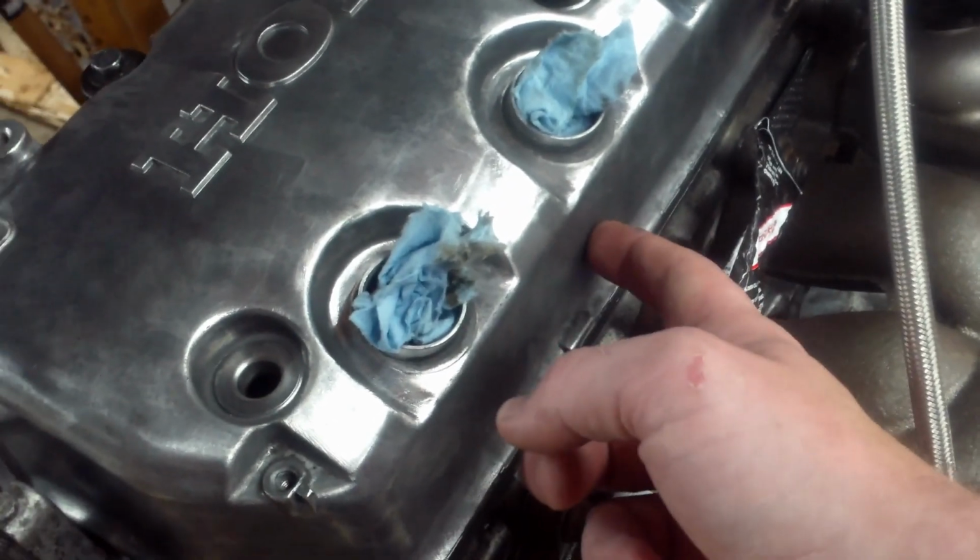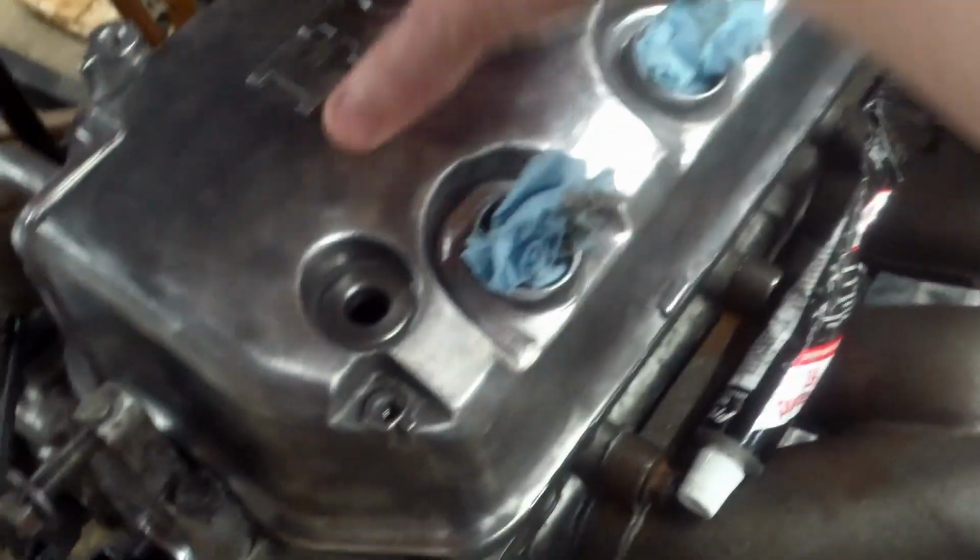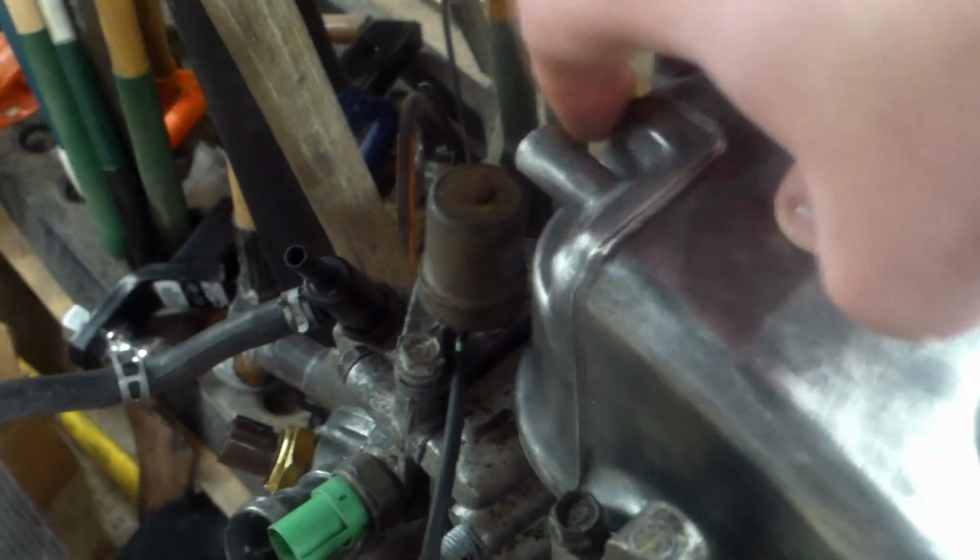Valve cover, I do have to weld something. I have to weld a bung in for the catch can to run for PCV, so for crankcase ventilation. The one on the back isn't going to suffice, and neither is this little guy right here. I was actually thinking of drilling this out and then getting the little bung welded right here. It looks stock, and it's baffled.